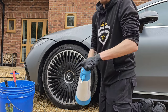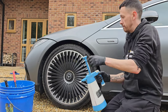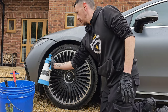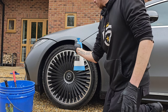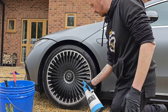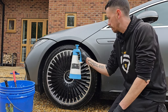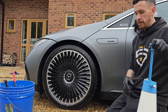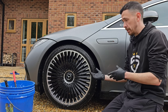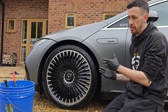First of all, I have a pump sprayer containing a non-acidic wheel cleaner that's safe to use on matte finishes. What we'll do is spray this under the arches first — it's a wheel cleaner, but it works great there, you don't have to use an all-purpose cleaner. Then spray it onto the tyres, and then onto the wheels, and leave that to dwell for a few seconds, safely breaking down the dirt. I'll then rinse that away before applying some lubricant to further clean the wheels — leave it for around 10 more seconds, then get the jet wash, rinse off, rinse under the arches, and continue the wheel cleaning process.